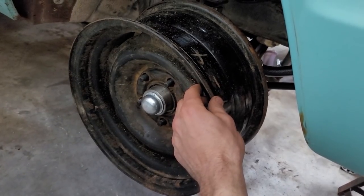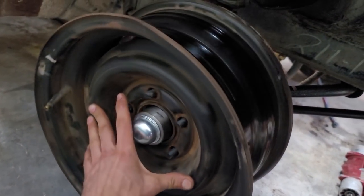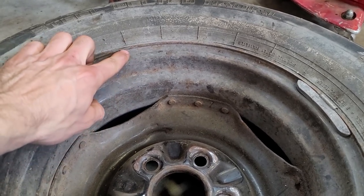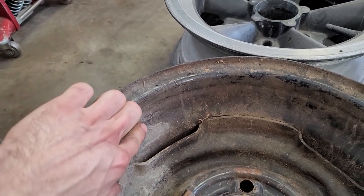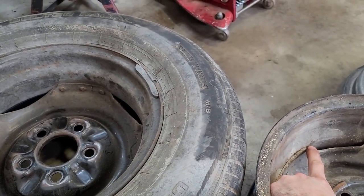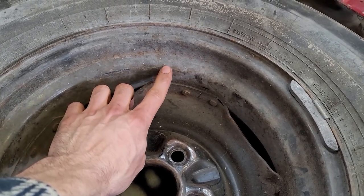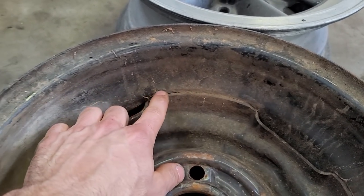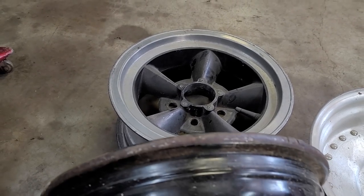This is not a compatible wheel with these disc brakes. So I got this rim here from the shed and as you can see it doesn't make any contact with the caliper. Here you can see the steppage of the wheel — basically the caliper is hitting this ridge right here. When we slide over to this wheel, you can see that ridge is a lot further down in comparison. This one is about an inch and a half taller compared to that one, right on the rivet line. So this one works, that one doesn't. I'm either going to clean up the face of that one and swap tires onto this one, or run those American Racing wheels — not sure yet.